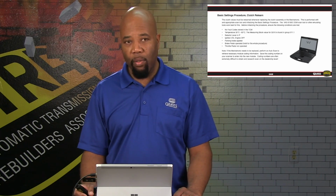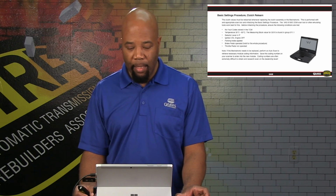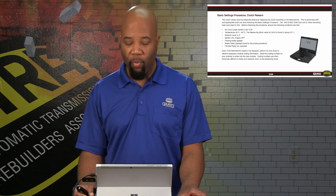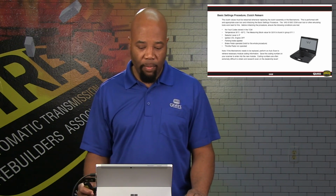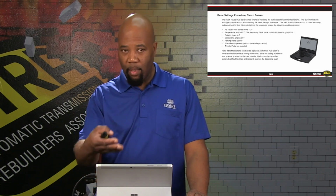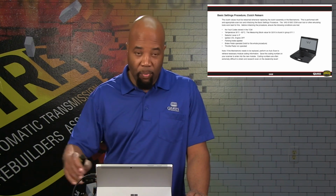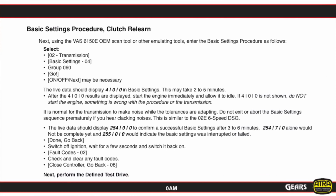So with that in mind, we want to make sure there's no fault code stored. We want to make sure that our transmission temperature sensor, that's going to be the G510 sensor, so we want to look at our scan tool and indicate that we are between 30 and 60 degrees centigrade to make sure that we are going to be able to perform this procedure. If we're not in that range, the procedure will not initialize. Then we're going to select park, ignition on, engine off, and then the procedure would initiate with the other items: parking brake applied, as well as holding the service brake, and we're not going to touch the gas pedal. Then we can go into the system and actually go through the system steps as initialized by the computer. We also give you a little bit more insight on this too, because sometimes it's hard to tell with some applications, especially Volkswagen, Audi.